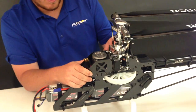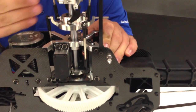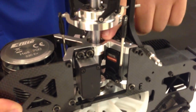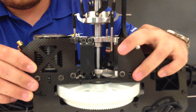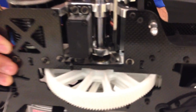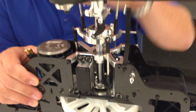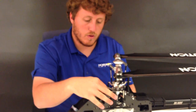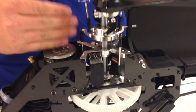We have a 12mm main shaft. Coming down we have this new servo geometry, so all the servo arms are in the correct plane of the swash plate. They're also all mounted vertically and mounted to the top bearing block in this middle tray. This middle block does not have a bearing in it, but it provides a super rigid block for the servos to mount on that is directly connected to the head, so you get really crisp cyclic. We also have these new servo yoke arms so the ball is perfectly centered on the output gear and you don't get any rock on the servo arm.